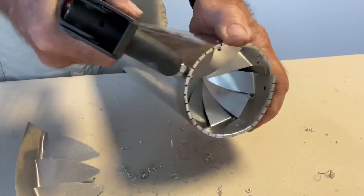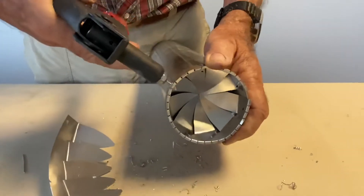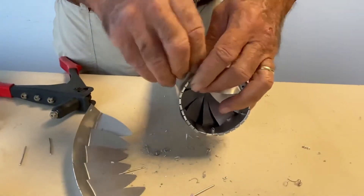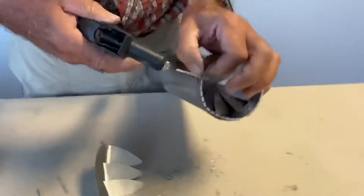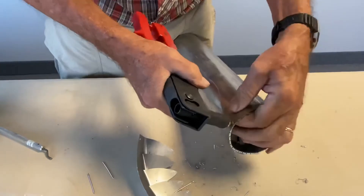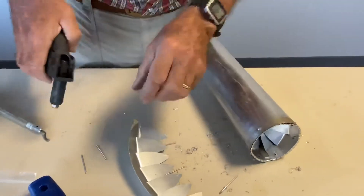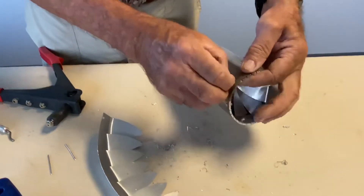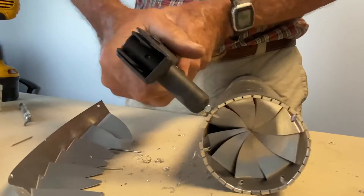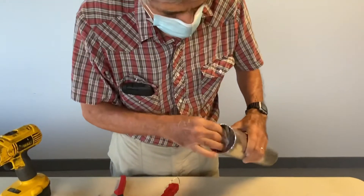Make sure to hold the gun against the tube. When you push it down in, you want the handle to be all the way up so it's not pushing the stem in. Then let go, push it in, tighten it up, and it'll let go. The idea is to have the rivet all the way in before squeezing — don't start squeezing until you're all the way down. If that doesn't hold it, squeeze again. They should all line up nicely if you had the little plastic cylinder in place. You can tap it down with a hammer if you want, but it makes for a nice easy install and the keeper is in place.